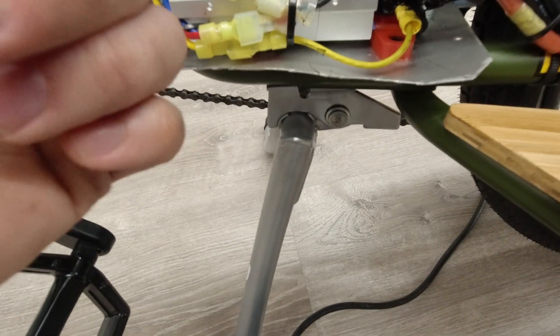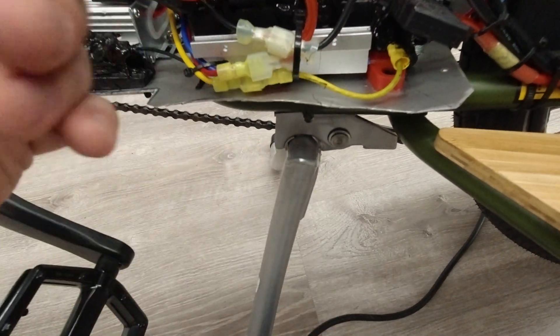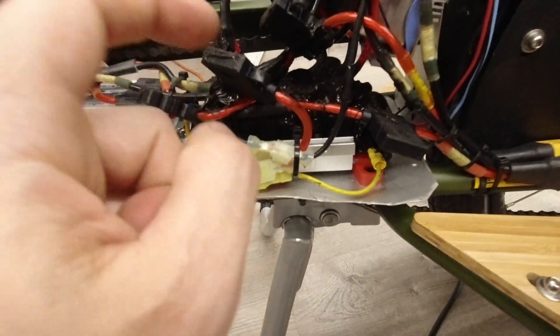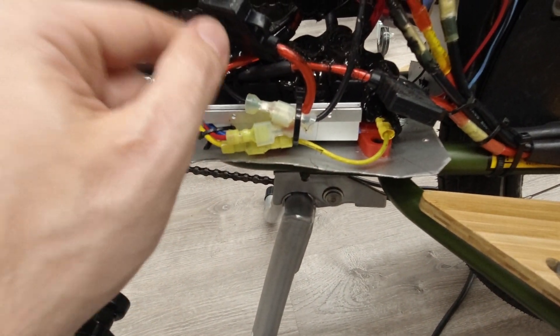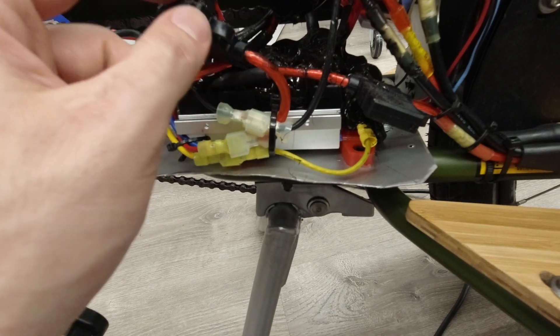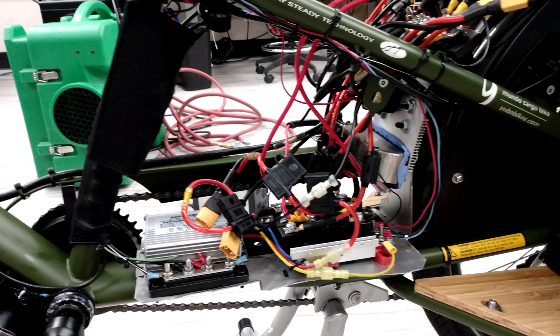Before, I used a 100-amp, 1,000 or 1,200-volt bridge rectifier. This time, since I have five batteries instead of three, there are two three-phase bridge rectifiers, and the outputs are combined. Each one of those is a 1,500 or 1,700-volt, 150 or 170-amp bridge rectifier. Neither of those is ever going to be used more than 90 amps — my peak today between both of them was 55 or 58 amps. They are attached to a G-Drive heatsink with a nice little thermal pad.